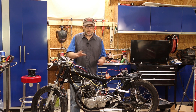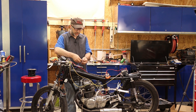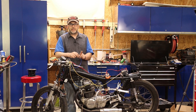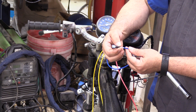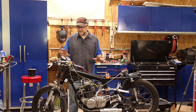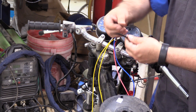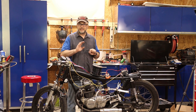Now I'm going to try to tidy this up — neat and tidy wiring will save you massive amounts of headaches. Every connector: I don't tend to use the heat connectors, but I always put heat shrink tubing over the edge of the connectors. I also try to use heat shrink that has adhesive in it, so not only do you have the crimp holding the connector on, but the heat shrink with adhesive just reduces the chance of that getting pulled loose. Loose connections can cause all kinds of hassles. I also have a spool of split loom wiring — it's just a tube that's spirally split. You can wrap it around and pull all the wires together so they're not going everywhere and won't snag on stuff. Neat and tidy is my goal.